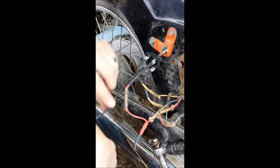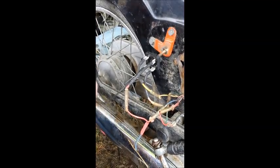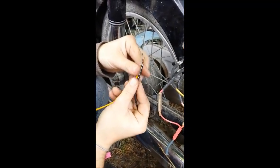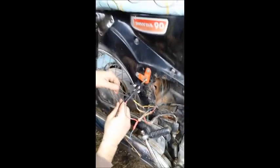And now we're all wired up. I just have to ground this out — I'm going to ground it along and put a new connector, and we'll ground it in together with the battery ground here. And that is how you replace your old selenium rectifier with the new Radio Shack model.